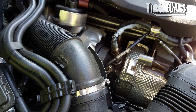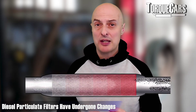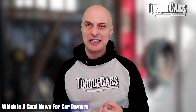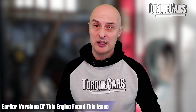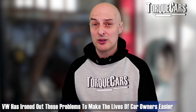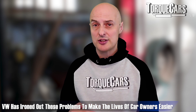The EGR has been completely revised — we'll talk about the different setups used on the EGR system. The DPF filters and regeneration cycles have been changed; it's been resited and is much more efficient, so you're less likely to have DPF clogging like on the early versions. Volkswagen have really looked at all the inherent problems people have had over the years with the direct injection, DPFs, and EGRs, and ironed these out.